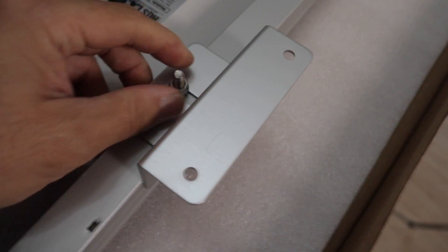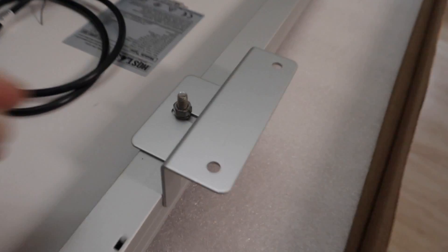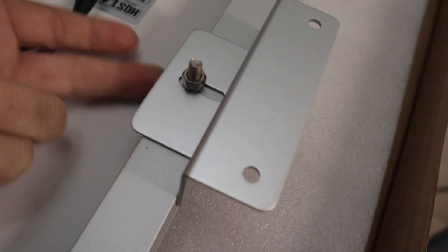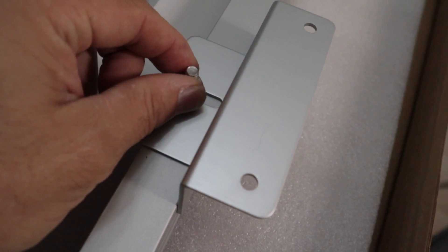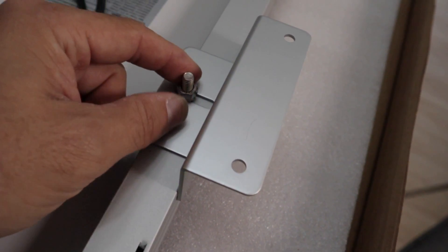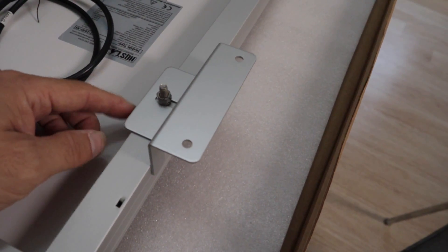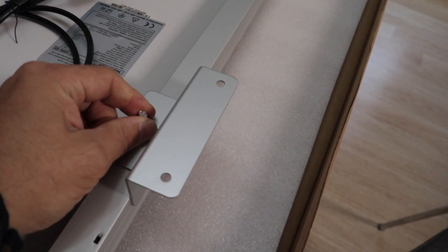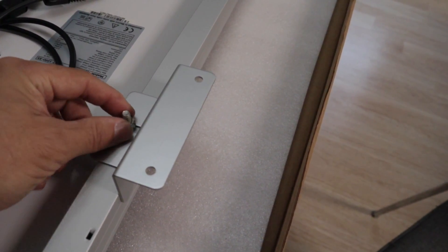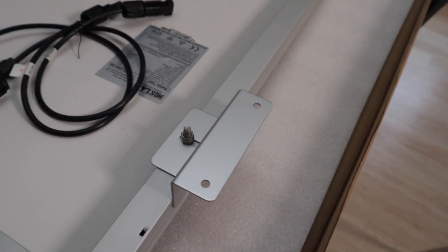Here is how I've decided to mount these panels — screw coming up this way, they don't come close to reaching the roof so no scratching. You put the bolt in with a washer underneath, a split washer on top, then screw the nut down. I decided to do it this way so that if I ever have to replace a panel, I can get a wrench or socket in there and loosen it without removing the brackets, since they'll be glued down with VHB tape.